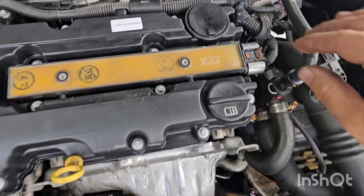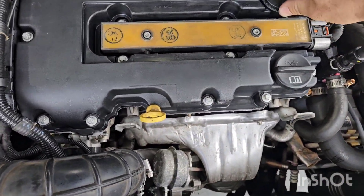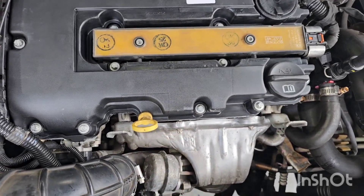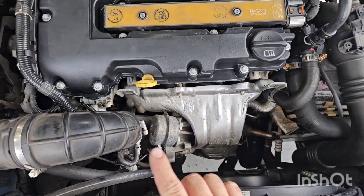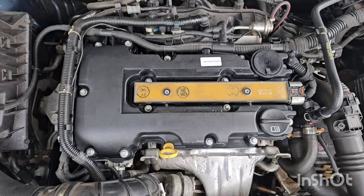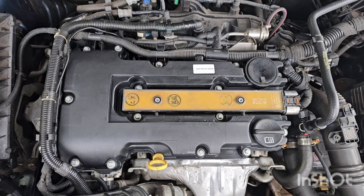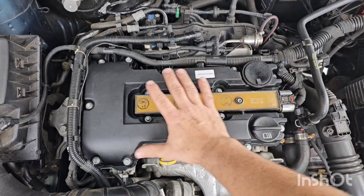This is good — this is fixed. No excessive noise from the dipstick now. Some noise is normal as some cars will run a little vacuum on the crankcase, but it shouldn't be excessive like before when it was making a big purge noise. I'll go for a drive and have a look at this boost issue to see if that's resolved as well. So that's pretty much going to wrap this one up for the lean condition, P0171, 1.4 Holden Cruze turbo petrol engine — have a listen for your PCV. Pretty common, and would also suit other cars with built-in PCV systems.